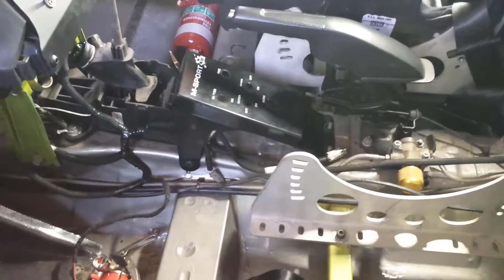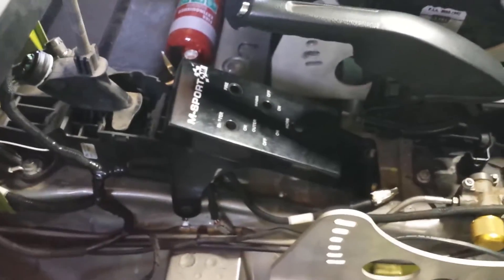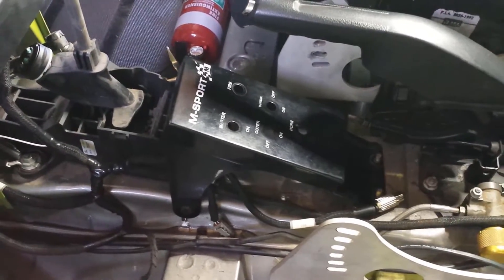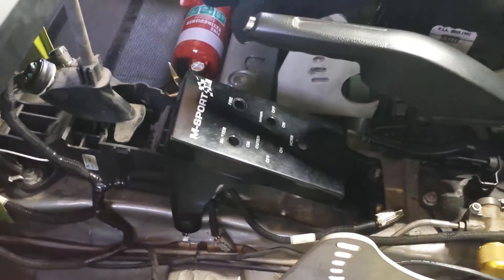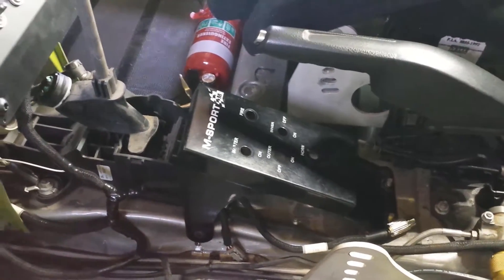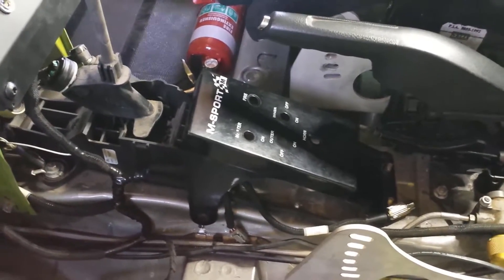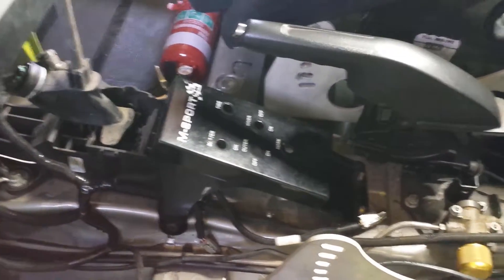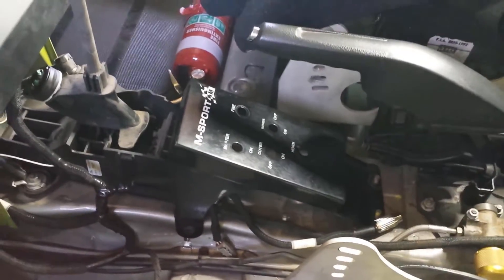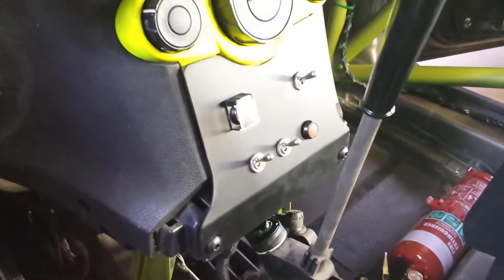The first problem we had was with the M Sport wiring kit fitted to the car. It has this neat little aluminium switch panel that's neatly bolted to the transmission tunnel, and that is right in the way of where we need to fix our new hydraulic handbrake. The first issue to overcome was how to relocate the switch panel. This proved to be a bit tricky because M Sport completely pre-wires this kit — the wiring loom is the exact length to fit in that spot. Moving it meant we had to be very careful, pull some wires back, cut some cable ties, and relocate the wiring a little bit.